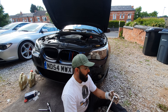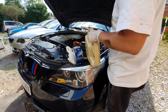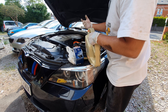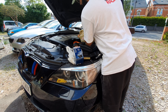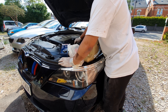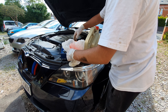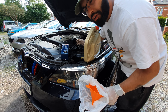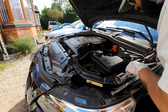That's the bottom of it done — everything you need to do from underneath the car. Just take out the drip tray and carry on with filling up the engine oil next. Take the oil filter out of the housing again and put a little bit of engine oil through the housing — not completely necessary, but because you've drained it all out it's good to get a little bit lubricated. It's another way of getting engine oil into the engine in a different area. It's a nice thing to also double-check underneath to make sure you've got no oil leaks and to confirm that you did put back on the drain plug.